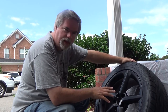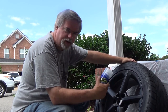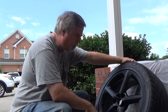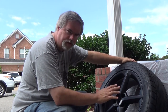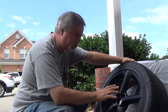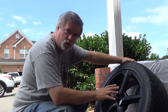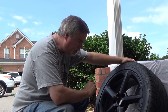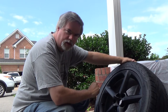I have my freshly painted wheel with the black Plasti Dip and I'm going to shine it up with some of the Plasti Dip Glossifier. It's going to provide a nice shine to the wheel. One of the keys is you actually have to give it a solid wet spray right from the beginning. You don't want to do a light first coat like you do with normal Plasti Dip - with the glossifier you want to go straight in with a heavier wet coat to give it that nice shine, and then it should dry that way.